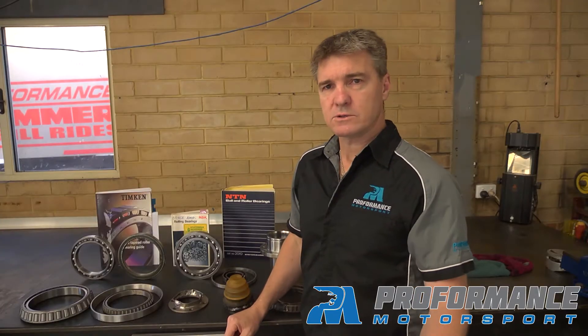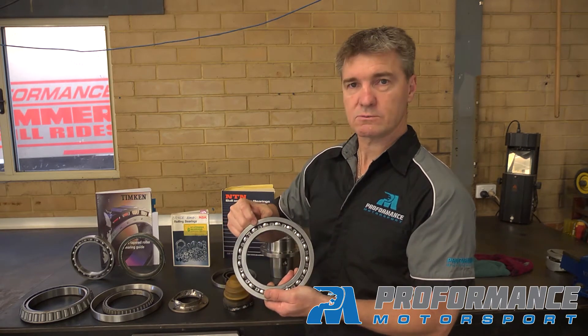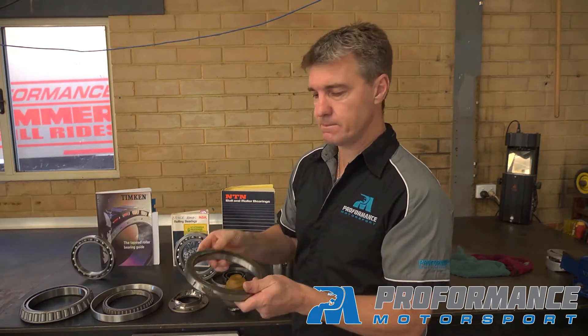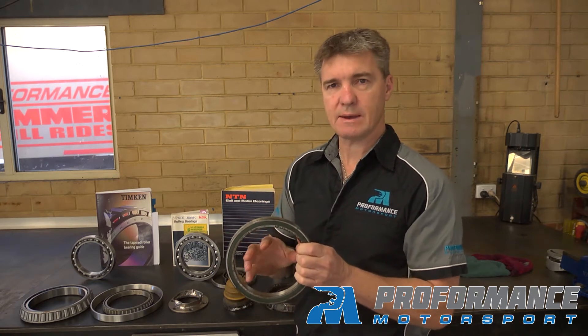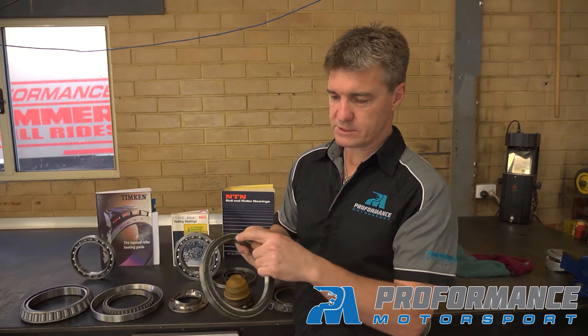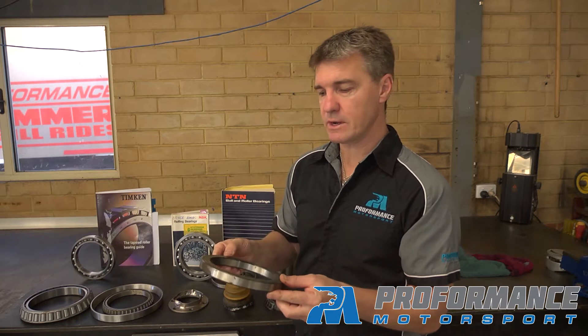The first thing I'd like to talk about is the difference between a bearing with a large ball or large roller versus something with a much smaller ball and smaller roller. In our transfer cases, portal hubs, etc., we always use large bearings so we don't have any splines and output shafts. We have the gears directly drilled with the CV bolt pattern directly in there, so there's no splines, no couplings, nothing to break.